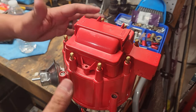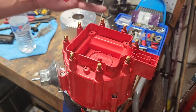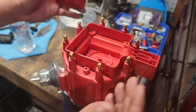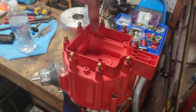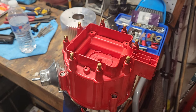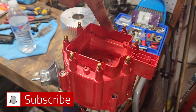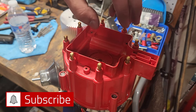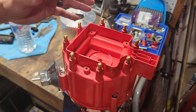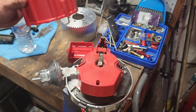This thing is in the same state it was when I pulled it out of the box — I just loosened everything and took screws out for ease of showing you guys. The very first piece is a nice dust cover for the coil; nothing wrong with that. But there's something missing in this general area and also down in there. There's no carbon brush, no gasket, obviously no coil, and the ground strap is not there. The wiring harness is here and appears to be fine.